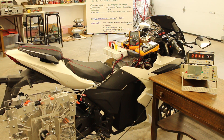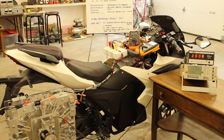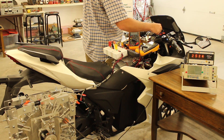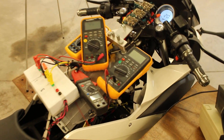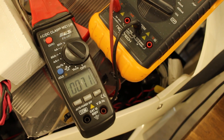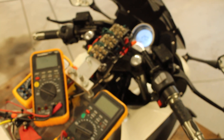Now we're going into regenerative braking mode. Our tachometer went from 25.36 down to 24.48 — we are in regenerative braking mode. The RegenX generator coils are delivering about 7.2 amps. The speed of the bike is 20 kilometers an hour.